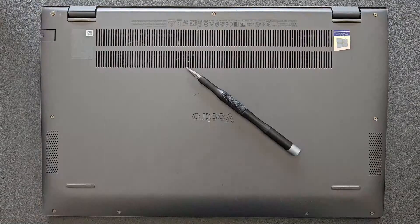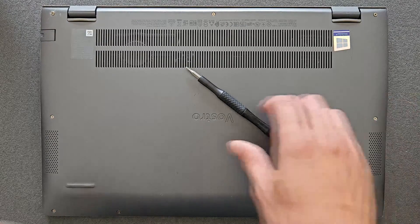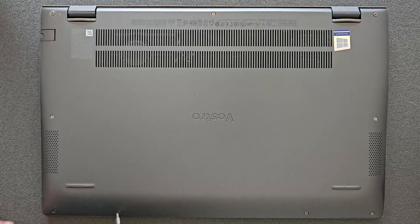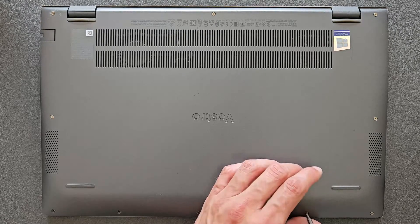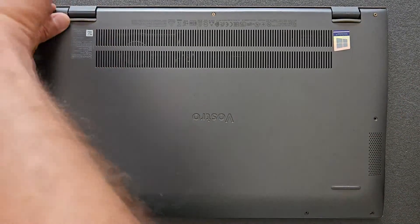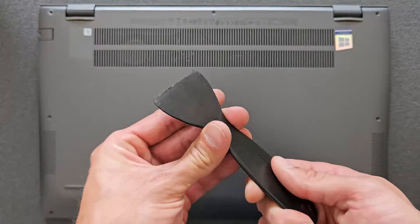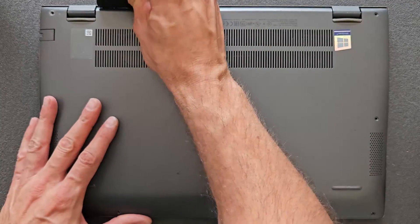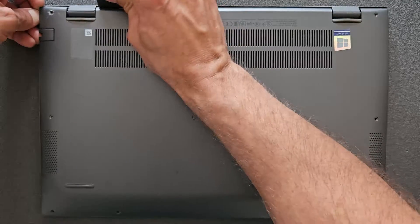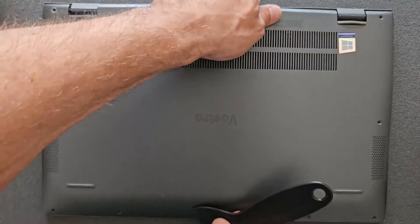You're gonna see how you can open up this little machine and what's happening inside of it as well. First things first, you need to remove the back panel and you need a pretty standard Phillips screwdriver. I'm gonna leave a link in description for the similar one or the same one - they're cheap enough, it comes with 57 bits in one so it's handy for other jobs as well. So remove all the screws from the back panel. They come off quite easy and same with the back panel, it does come off quite easy. If you have a pry tool like I have it's gonna be just that much handier. If you don't, I don't recommend using anything metal - no screwdrivers or anything like that, you're just gonna break your laptop or damage it at least.